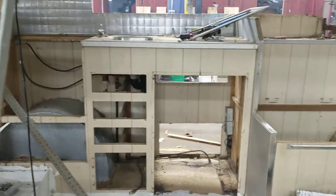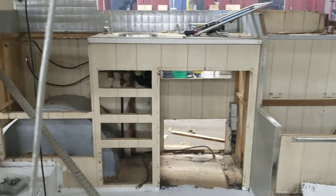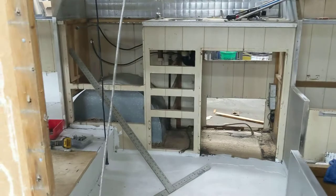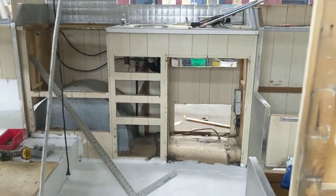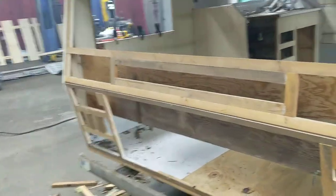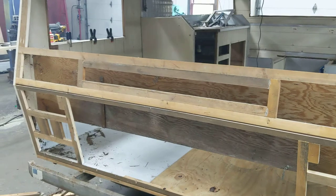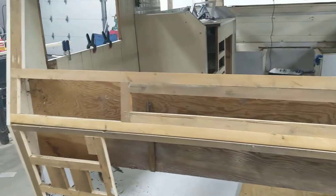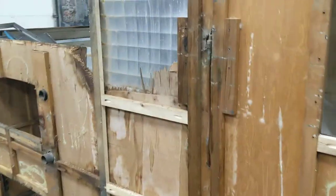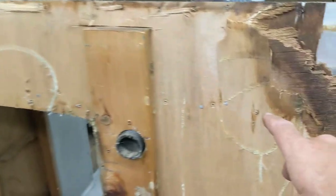We're going to go over the paneling that's in here with new paneling and build all new cabinets. But right now we had to leave those cabinets in there because, believe it or not, the cabinets are actually holding that wall up on the other side — the cabinets are stronger than what the wall was at the moment. These things are built from the outside in: they start with a floor, set all the cabinets inside the camper, stand the walls up, and fasten the cabinets from the exterior of the wall into the cabinets.